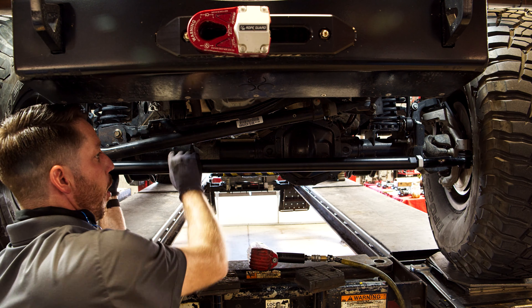Install the bottom of the clamp. If you have the adjustable Falcon Stabilizer, rotate the knob all the way to the left so it is in the soft position. What you will see when you look at it from the front is the back of the knob. Simply loosen the bolt at the end of the knob. You may need to remove it completely if the knob won't break free from the shaft, which can happen if there's a lot of crud in there. Rotate just the knob until the word 'soft' faces forward and tighten down the bolt, holding the knob in place as you do so.